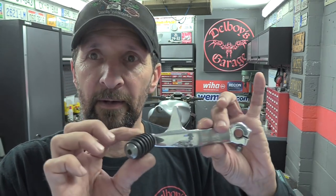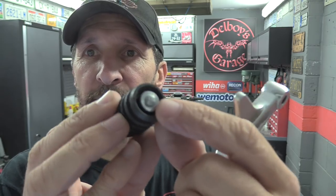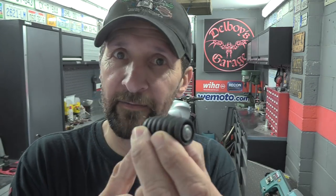We were parked on a slight downslope, there was no option. We had to park there — probably should have left the bike in gear, but we didn't. It rolled forward slightly, rolled off the stand and fell on its side. As it fell, that was the first casualty — snapping off. Once that was out of the way the arm itself took a hit on the ground. This pin through the center has sheared, and the remainder of it is still in there. So that's the task today — drill that out.